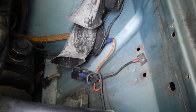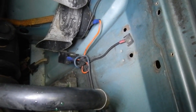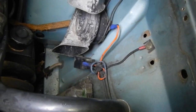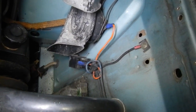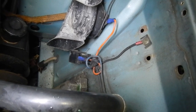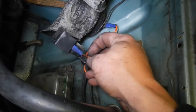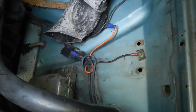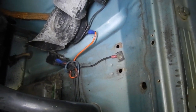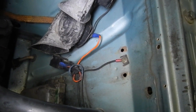The horns weren't working in this — I wasn't getting any power and I was like, what's going on here. I noticed the little relay just flapping around down there, so I took out the expansion tank, which is full of muck. It's got one wire running from the positive on the battery, seemingly unfused, all around the front of the car to this relay, which is broken off and just flapping around down there. None of it seems to be working — looks like I've got a little bit of wiring to do. I might put a fuse box somewhere for the horns and at least the high beam headlights, and a few other bits.